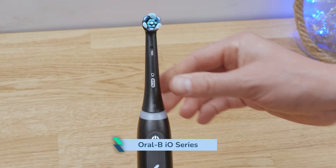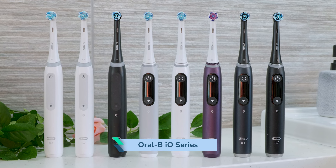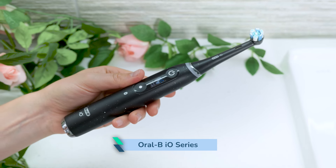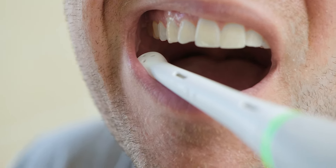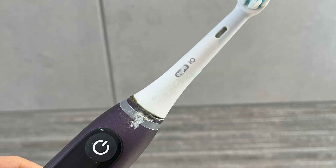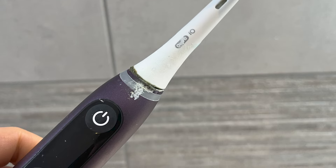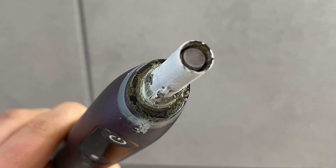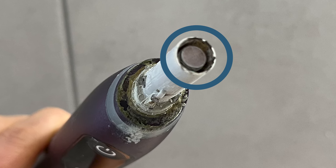When moisture is allowed to get inside the head, it is almost impossible to prevent some sort of build up entirely. Unless you apply heat or somehow thoroughly dry inside the head, there will always be residual moisture that wants to escape at some point. Some will remain trapped. Assuming the head remains connected to the handle, or placed on top at least, the only escape route is down the handle itself. This is physics in action. But the problem is exacerbated with the IO models, because the top of the brush handle where the head connects has a different attachment design. The gap between the magnet and the outer plastic tube gives a place for the residual moisture in the head to find its way into.